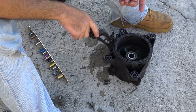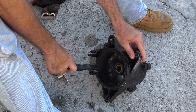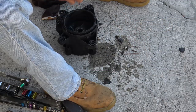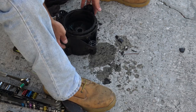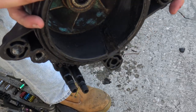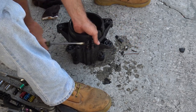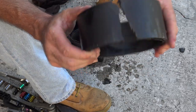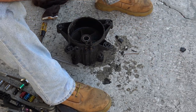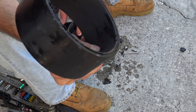Make sure you don't cut through the wear ring into the pump housing — that's not what you want to do. You can see when you get close it's hard to get in the back, but when you cut a notch, you can knock it out with a chisel and start getting the chisel in behind there and it pops right out. And after a lot of cutting, pounding, and swearing, I cut a groove in that wear ring and you just pop the thing out. It makes it so much easier when you chisel that piece out. Wear ring's out — and that one actually looked almost new. There are really no grooves in it.